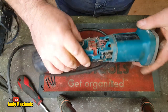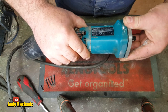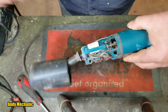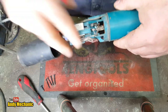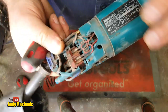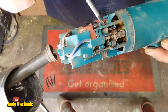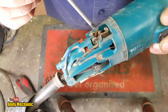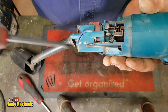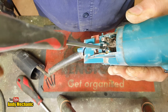I wonder if that's going to come out with the armature. Maybe we've got to get the brushes out first. We've got just down here - we can see one of the little brush springs, and another one down here. And these look like little retaining screws that hold those brush packs in place, so we'll undo those and get those brush packs released from the commutator.